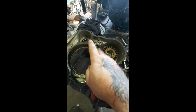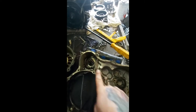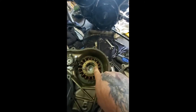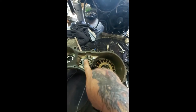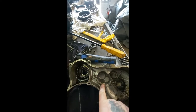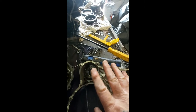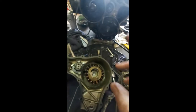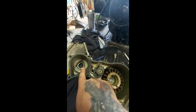These are the two rear engine covers. This is the one that's come off the bike and this is the one that's going on — I've removed the output shaft bearing. The windings for the alternator sit inside here and the clutch will eventually go in here. That's the original kickstart mechanism, which isn't on this one because this is the case from a newer engine. I don't need the kickstart mechanism anyway because it's on the side of the sidecar and I'd never be able to use it.